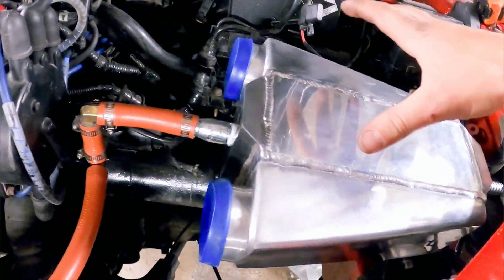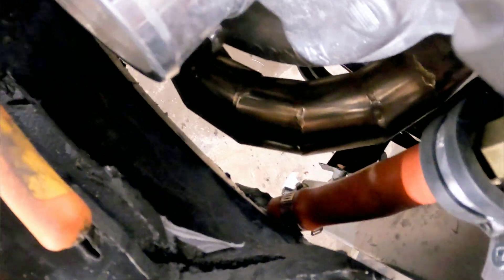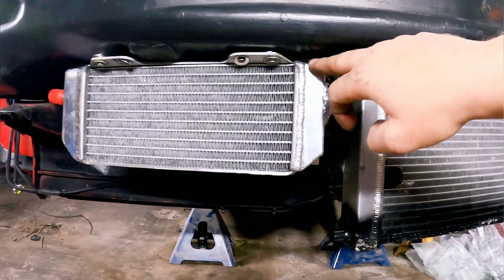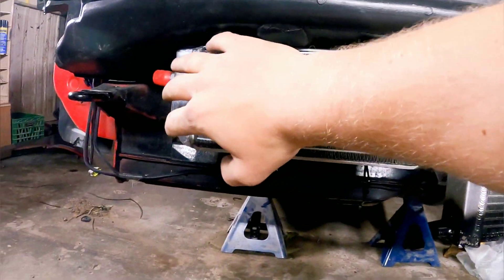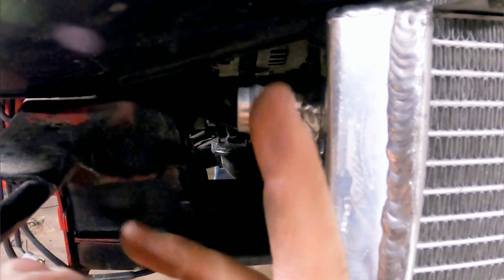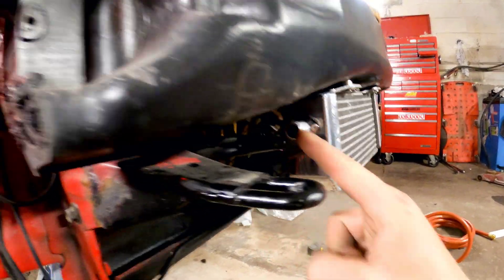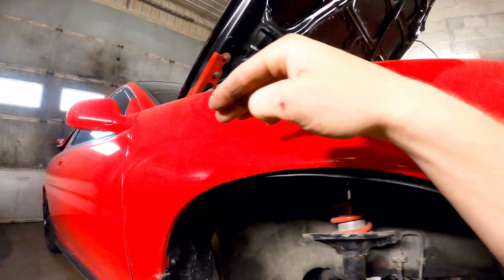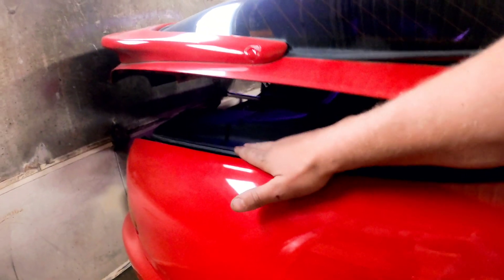All right, I've got most of under the hood done. I've got the outlet of the intercooler where the warm water goes through, down and toward the rad. It's already on my inlet. It'll come in through right here at the very top of the end piece, fill up, the water will go across and come out of here. I have to run this to the trunk at the top of the tank. I'm going to go from the outlet on the rad over here, then underneath the plastics on the wheel well, up into the wheel well, back into the car underneath the carpet, and all the way up to my water box.